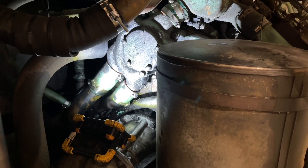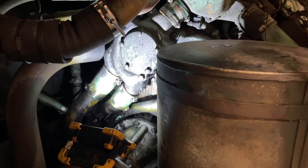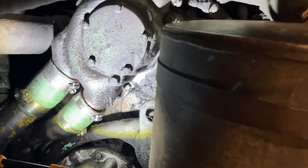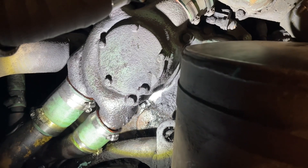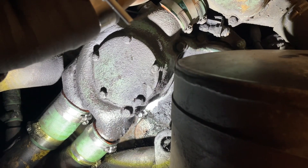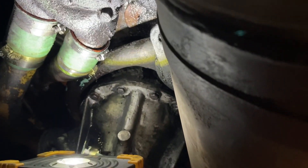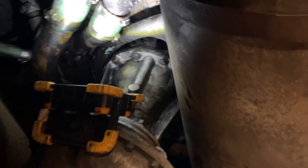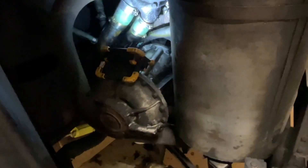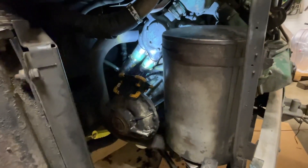Basically, it's the oil pump — it's a gear-driven oil pump. On the back side of that oil pump there's a large O-ring, and that O-ring is leaking between what you would call the camshaft cover or gear cover and the oil pump. It's dripping down here onto the fan drive extension. We took the fan off so we had better access behind the radiator.